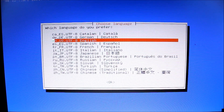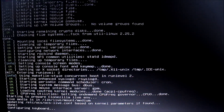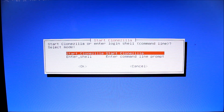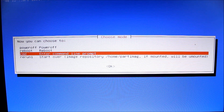We're at the language selection — I choose English and hit enter. Then go into the key map; my keyboard is a standard English keyboard so I don't need to change this. I just hit enter for my standard keyboard. Here we are at the CloneZilla page. What we need to do here is change it to Enter Shell, because this is the target computer and we need to put in shell commands. Hit enter, then you get four options — the third one, CMD, is where we need to go. Now we're in the command line prompt.